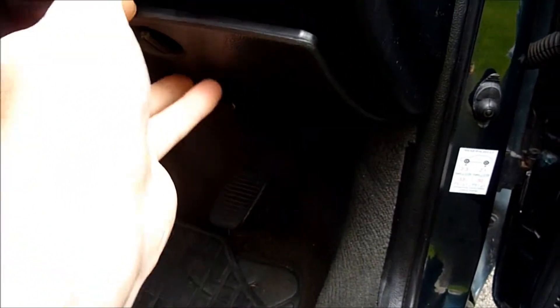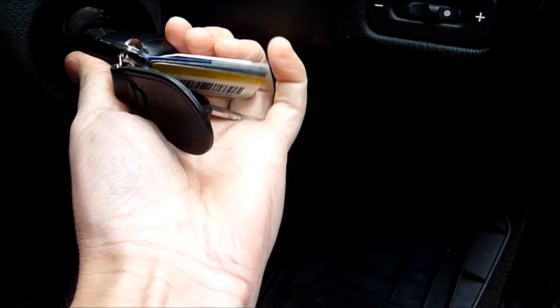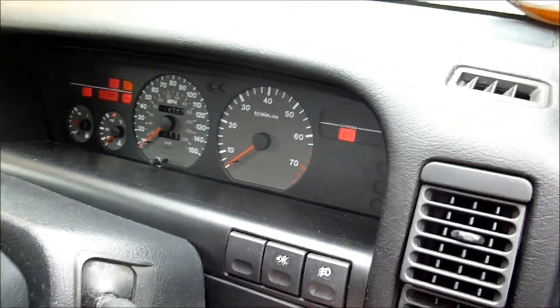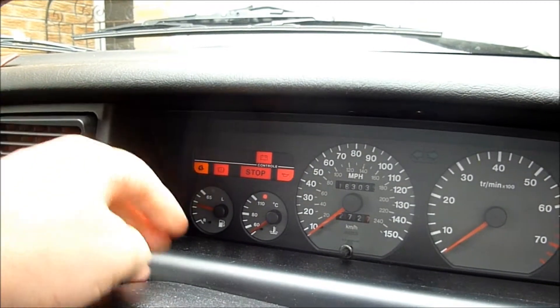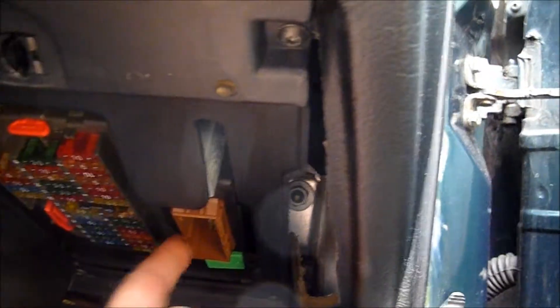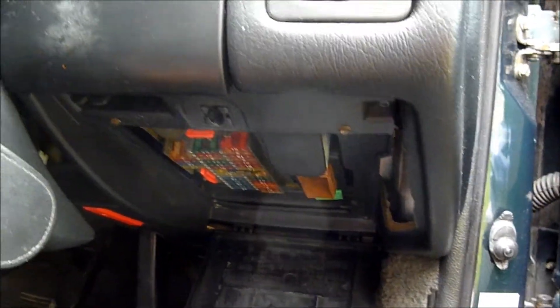So if we go to the fuse box here, open this up. The first thing we'll do is put the ignition on. The steering lock's on — all done. So I've put the ignition on, the engine management light there comes on, and we'll put the code in. The code's in, so the engine management light there is on — that's what we'll look for; that'll start blinking and give you the blink codes. But here, you'll see the connector down there. I'll get a light in — this is the connector you want to look for. That's the one which we'll put C2 to ground. I'm going to use this grounding point here, and we'll just put it to ground for five seconds, and then we'll be able to read the blink codes which we'll see on the dash here.